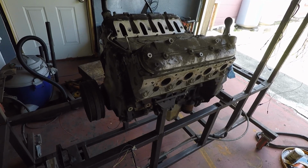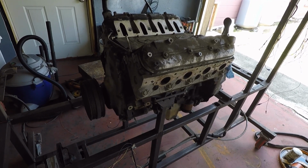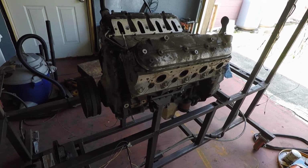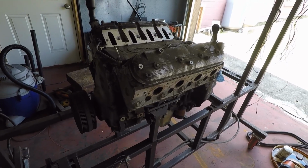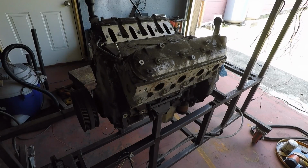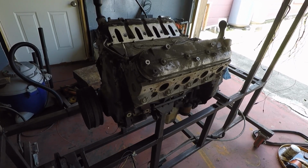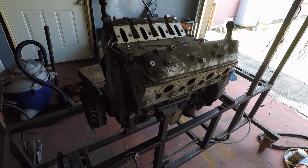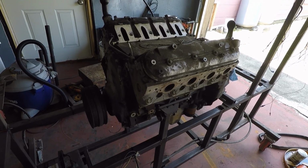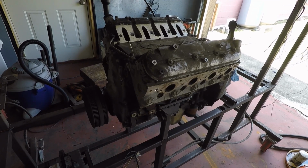So that's going to do two things. Now I've done 6 or 7 engine starts this way, where I actually use the starter, and if you notice there's no plugs in it, so there's no real resistance on the motor. I'll use the starter, of course that's attached to the oil pump, so we'll be pumping oil through, so that'll pre-lube the engine. And it takes about 10 or 15 seconds sometimes on these, so I'll just bump them over lightly and then slowly start rolling them over.